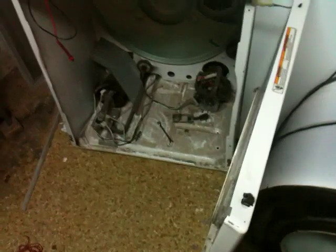Of course, if this should happen to you, you'll also want to check your vent tubing to make sure that it is indeed not plugged and that there are no other problems. And while you're in here, now this is a scratch and dent dryer. This thing was hit when it was new with a forklift or something, so it's dented. And the tub may not seal properly on it, which may explain all the lint that's inside it.